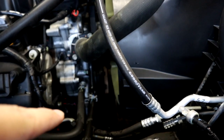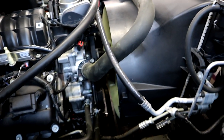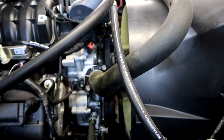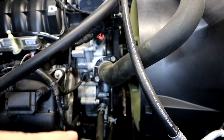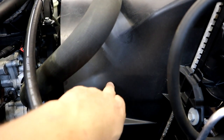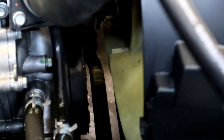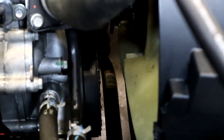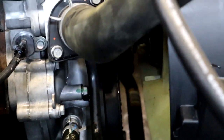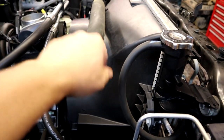We've got the Maldon thermostat installed. Next up is removing the factory harmonic balancer, then doing the crankshaft drilling and putting on the Torque Storm ATI pulley down on the crankshaft. To make extra room, we're going to remove the fan shroud and the clutch fan to clear out this whole area — it's kind of jammed up right by the bottom of the fan. So we're going to get that out of the way and continue on to the hard part.